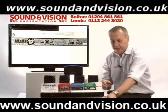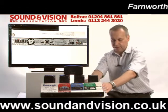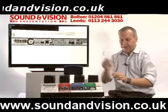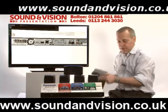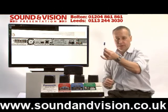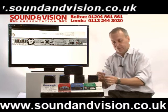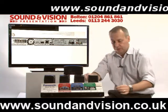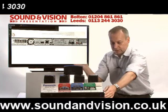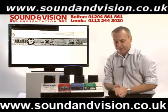All the sockets are colour-coded, so if I just unplug one of these now for you. The actual speaker connection, for instance, for the subwoofer, which is this unit here, has a purple plug on the actual lead itself. All the sockets are colour-coded on the back of here, purple, green, red, and so forth. You just push the corresponding coloured plug into the corresponding coloured socket, which you'll see on the screen here. Now, very straightforward, very easy to set up.